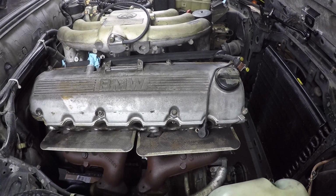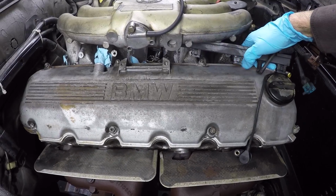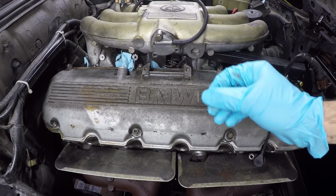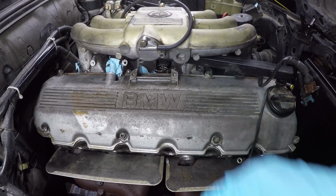So I found out there are 2 different fuel injector connectors going on with fuel rails on these E30s. And I have the older style electrical connector. And these use these C-looking type wire clips. And there's really no way to get these off of there unless you mutilate the connector a slight bit, which is what I had to do.